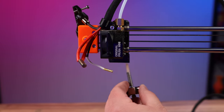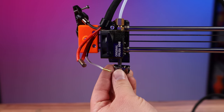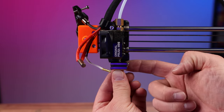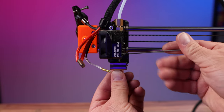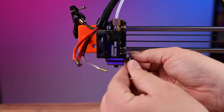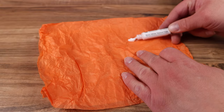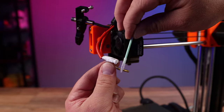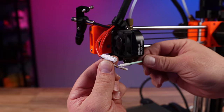Take your new Copperhead hot end and insert it into the heat sink. Make sure it's in the correct orientation — the flat part of the hot end is in the back and the two holes are on your right side if you're looking at the printer. While holding your Copperhead straight, use a 1.5 millimeter Allen wrench and tighten those three screws we loosened earlier. Using the foam swab that came with the kit, put some boron nitride paste on it and thoroughly coat the heater cartridge and the temperature sensor all the way around.